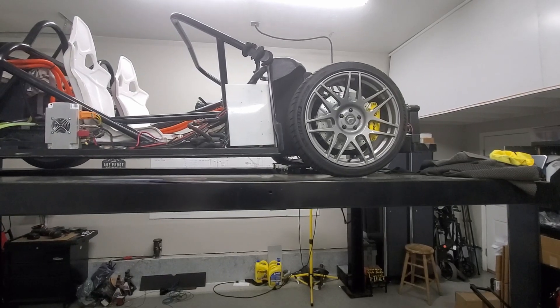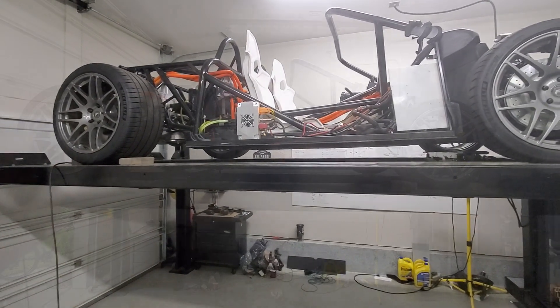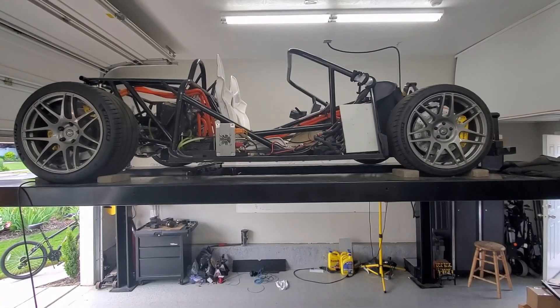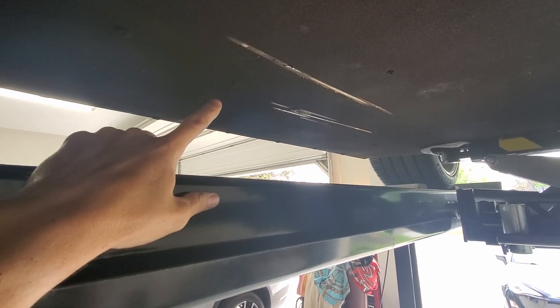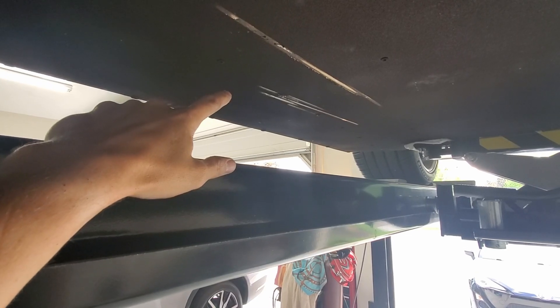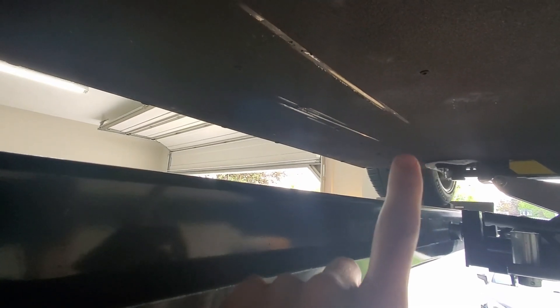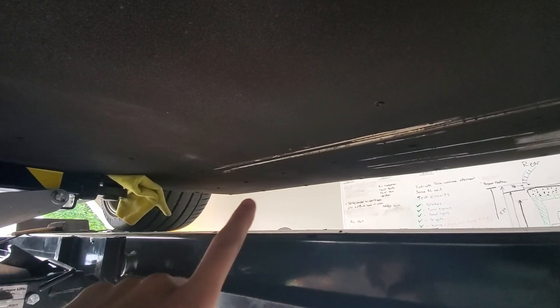I added about an inch of ground clearance in the front, then did the same in the back. Now both front and back are raised up an inch from where they were. The low clearance was making it hard to get on and off the lift even with long ramps. It's not really scratching the fiberglass — just the rubberized undercoating. I raised it up and gave it a light sanding and sprayed another coat. The thought is just to see how much and where I'm scraping as I dial in the suspension.